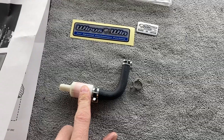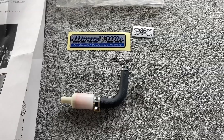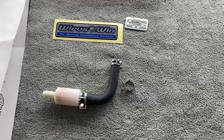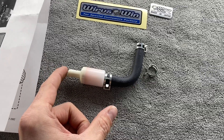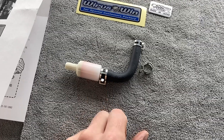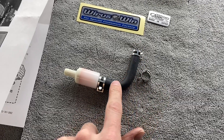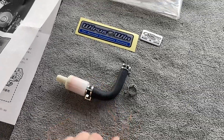This also acts to reduce condensation as well. With the stock one, it's just a wide-open breather tube. And if you put an air intake on it at the end of your breather tube, you had to put a breather tube filter on. With doing so, you pretty much have more air inside the breather tube itself, and you're going to get condensation built in there as well. Right here on the end of the hypervalve, it actually stops — you blow into this side, nothing's getting back in. You blow the other side, there's a spring and probably a ball in there that's going to stop it. So when the pressure is built up on the cylinder head side, it will allow gases to go back. If pressure builds up enough, it's still going to allow the gases to escape. So this is supposedly better for your fuel economy and also better for your oil — less condensation going back in from the breather tube.